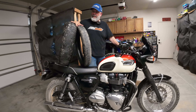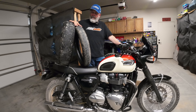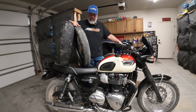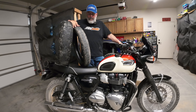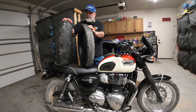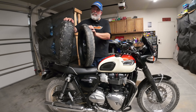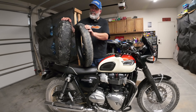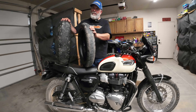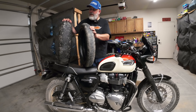I would not count them out. People really don't seem to like them, but I had a good experience. Triumph does seem to still fit all their bikes with these tires. This 2017 to 2020 generation Bonneville has an 18-inch front and a 17-inch rear — 17-inch rears aren't too hard to find, but the 18-inch fronts are a little tougher. These were fairly readily available; I had to order one from one supply house and one from another, but I wouldn't discourage you from riding them out to the end of their life cycle.